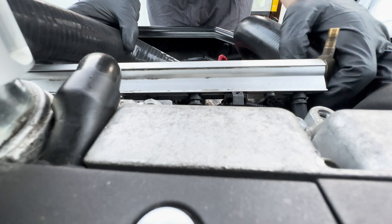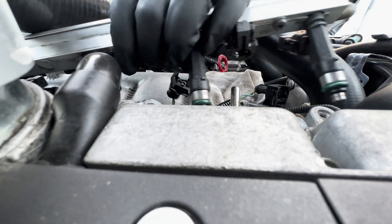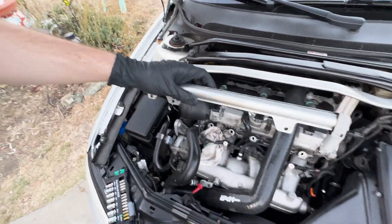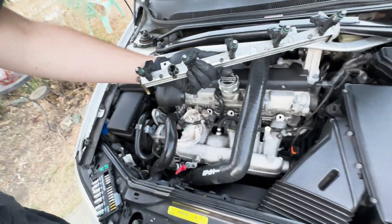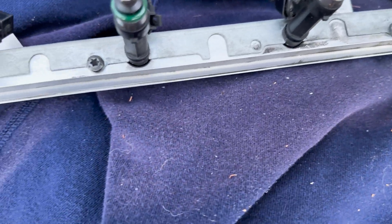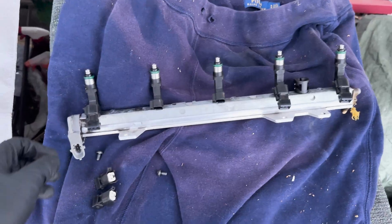Because I was lazy and left my charge pipe in, it makes it a little more difficult to remove my fuel rail, so I'm disconnecting the fuel injector electrical connectors and then maneuvering the fuel rail around the pipe. As a caution, I'd recommend avoiding holding it upside down because fuel will leak out. Once you've got the fuel rail out, there will be three Torx sockets - I believe they are T25. You want to completely remove all three, and if you have piggybacks like me, you will need to remove them in order for the metal slide to come out.